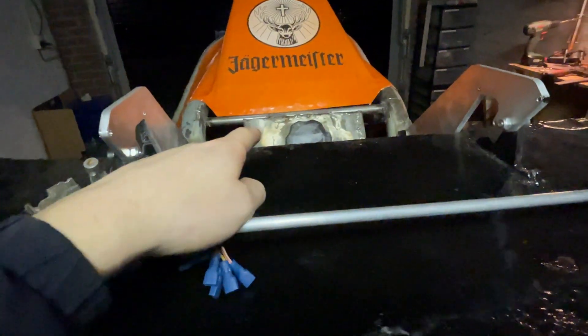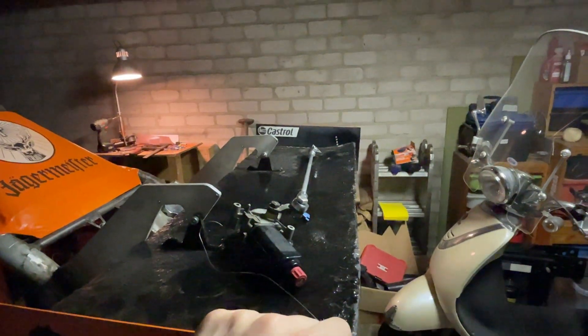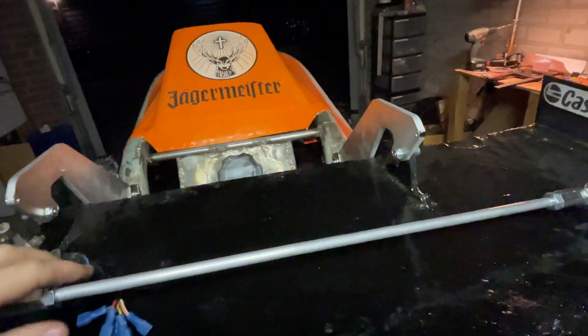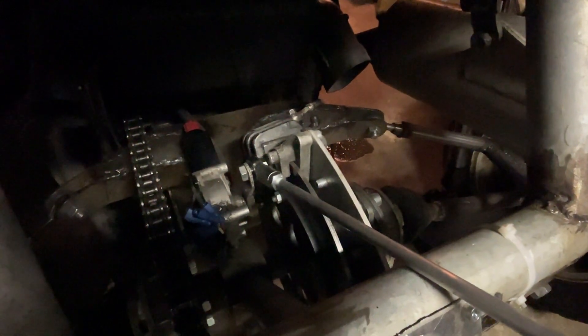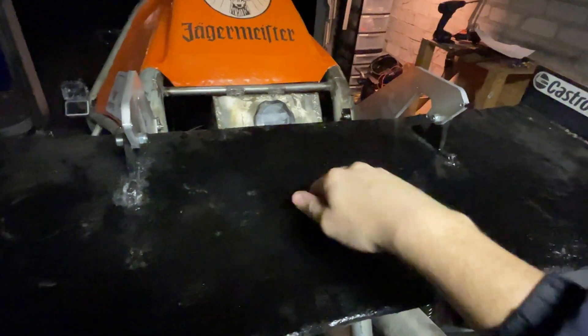I want the motor at the top of the wing so it would pull the wing over — if the motor is activated, it pulls the wing just like that. Unfortunately that doesn't really work with my CAD drawings, so I have to do something else. The electric motor is over there and the push rod is over here, probably between the sprocket and the rear brake disc. I don't think there's a problem with clearances as long as I keep the cables really close to the tubing. The push rod will be mounted underneath the wing.